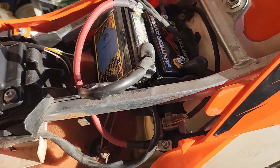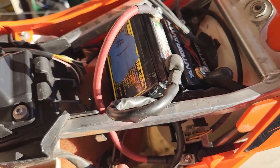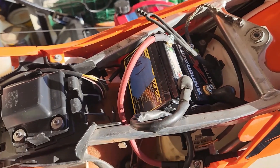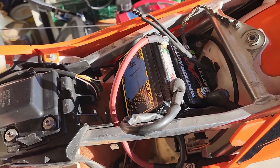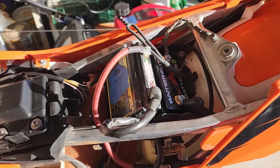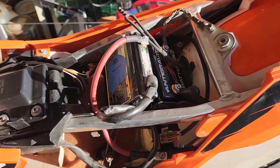It's worth mentioning that everything I've done has been on the starter side of the starter solenoid. I've taken off the cable from there, attached the one that goes to the negative terminal on the four-cell, and connected the cable that goes directly to the starter — so only when the solenoid has made its connection am I getting 24 volts to the starter. If you get confused and disconnect any terminals from the main battery, you could inadvertently hook the batteries in series and put 24 volts through your system, which will severely damage all of your electronics. So don't make that mistake.